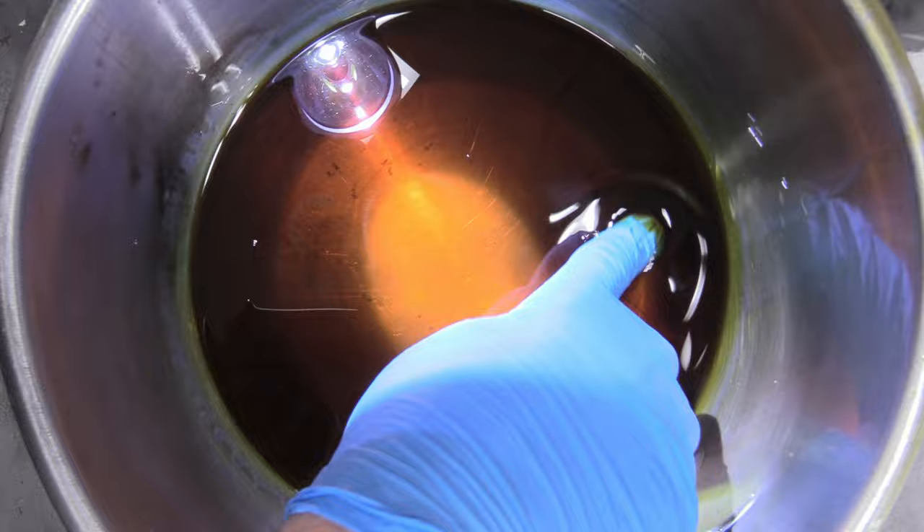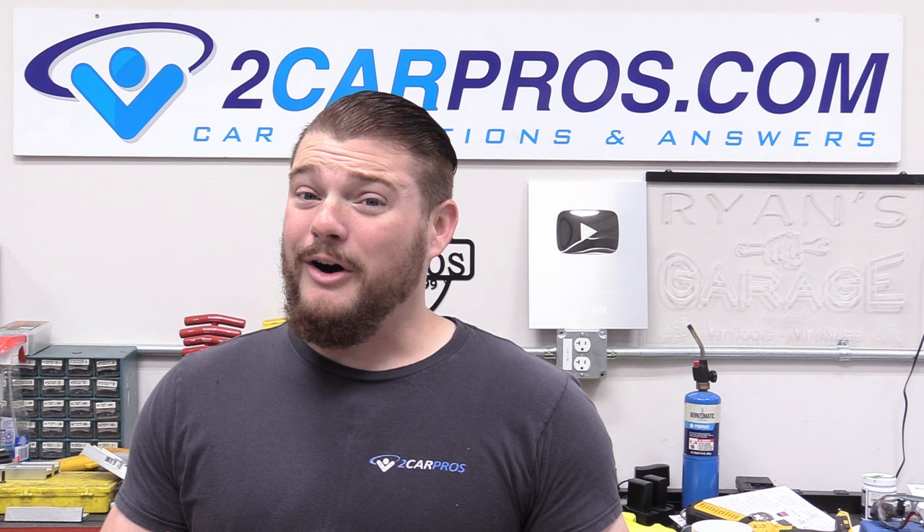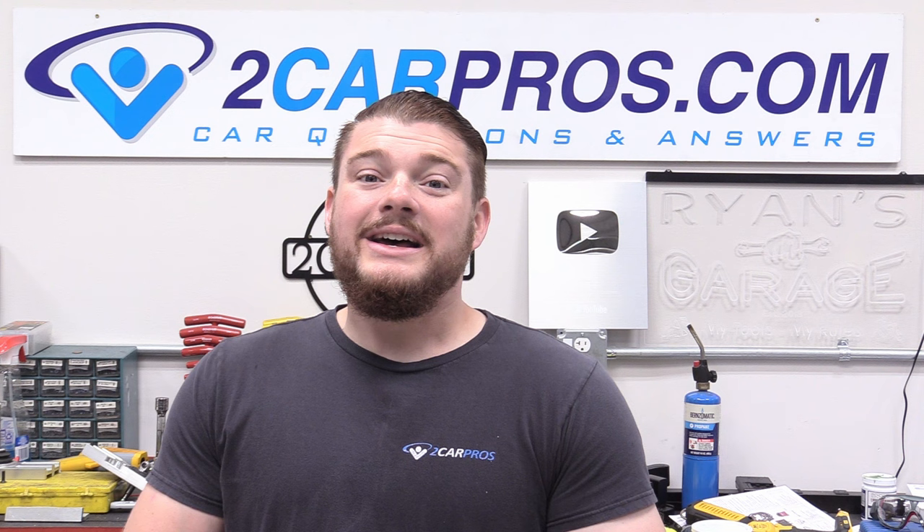So I think that's pretty conclusive. The filter is definitely doing its job, but there was metal in there — I really didn't expect to see that. I thought it was going to be pristine. For my money and my engine, engines are expensive, oil's cheap, filters are cheap — probably a good idea to change the oil. The old adage definitely stands in my book. Even when the dealer says do your first oil change at 12,000 miles, I'm going to have to highly disagree with that. This has really confirmed what all the old guys, my dad, and grandfather have always told me: myth confirmed — definitely change out your break-in oil with a new fresh set and a new filter. Thanks so very much for watching; if you found this video interesting, please consider giving it a like or subscribing.